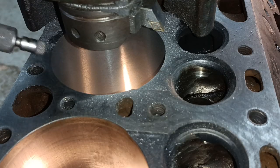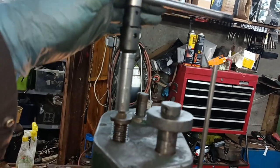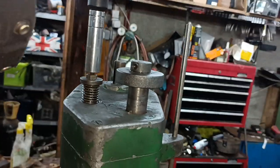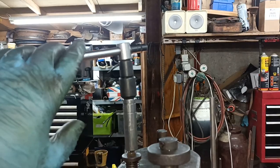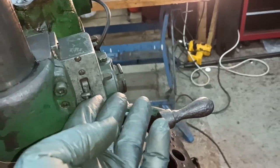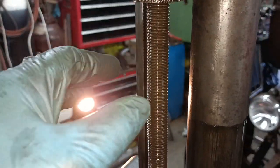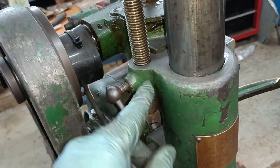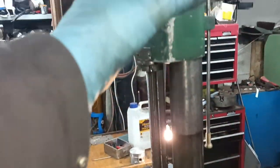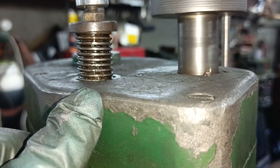This will be the last cut on this bore. This is where I wind the thing up and down here with this. I've had to modify this because the nuts won't release. So I wind it with this Tommy bar. And when you turn it on with that old-fashioned switch, this nut rotates, and as it is at the moment, it's taking that screw with it. When I stop the screw from turning, the head winds itself down the screw. Can you see it's winding down the screw?